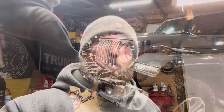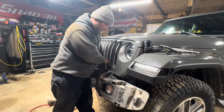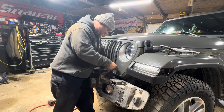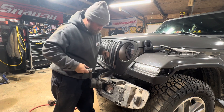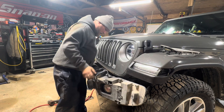I need coffee — I haven't had any yet this morning. I'm down to the last nut here. You can get to all of them with an impact, but I was scared that if I took them all out with an impact they'd fall while I'm laying underneath — didn't want that to happen. They're all loose now, they're all off. There are two brackets like this per side as well. Now let's slide this bumper off in theory.